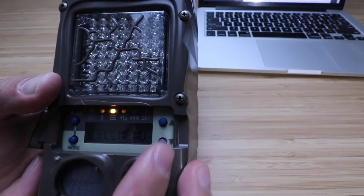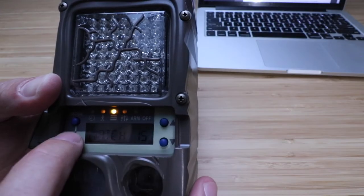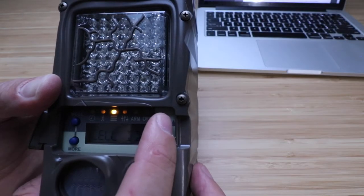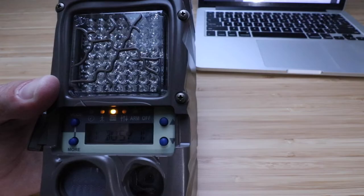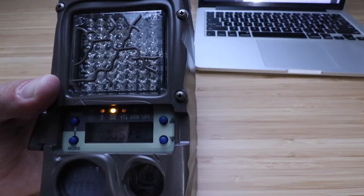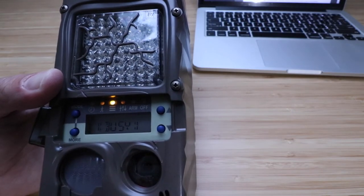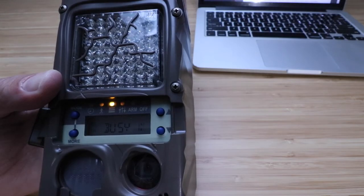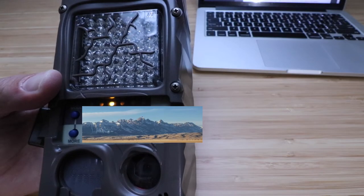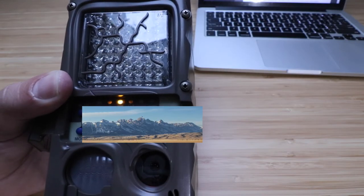Click 'Up' twice to select Cell ID. It'll say busy and then give you the ICC ID in 20 digits, displayed across four screens of five numbers each. Write down the first set of five numbers, then click 'Up' to get the second set. Continue clicking 'Up' for the third and fourth sets. Once you reach a number starting with 'M,' that's your IMEI number — you'll get three sets of IMEI numbers as well. Write all of these down.